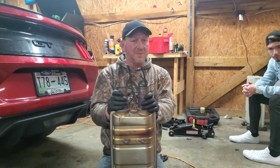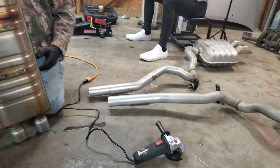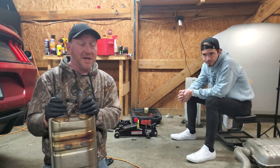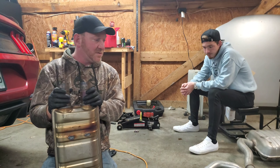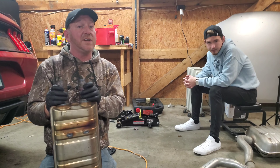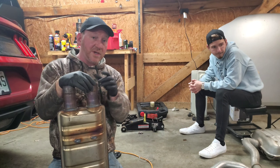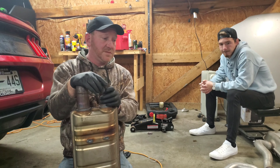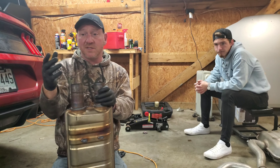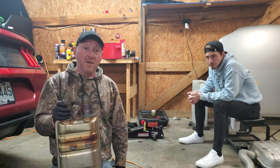We're about to put the right side muffler in — the driver's side. We had to flip it over to finish the cutting. Die grinder with the metal cutting wheel — less than five minutes, we're through on both sides. That was super easy and quick, this metal cuts so much easier. Make sure you wear safety glasses for sure, and if you have a face shield, do that too — face shield is a whole lot better.